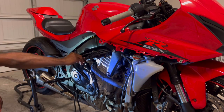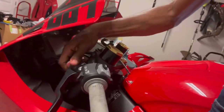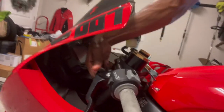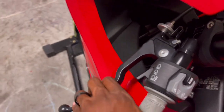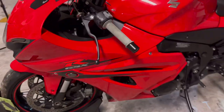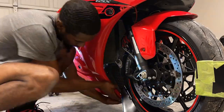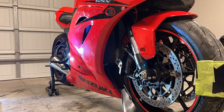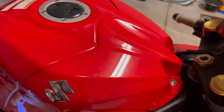Oil and filter have already been drained and changed out — now we just need the fresh oil back in. Nothing like a little Crisco for the O-rings. Last but not least, adjust the clutch lever and bar back out — there should be a little bit of play. Everything's back together, fluid check done — clutch is adjusted.